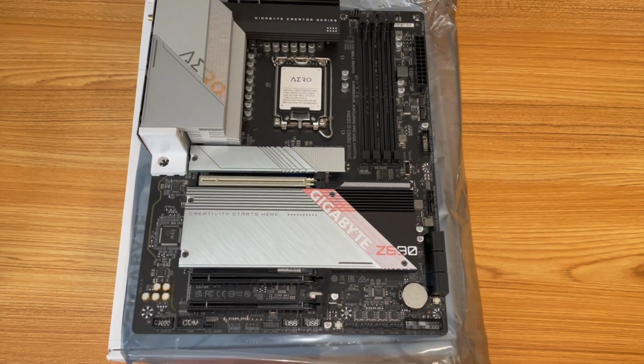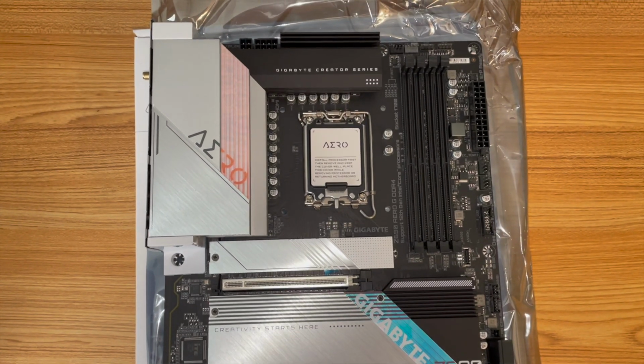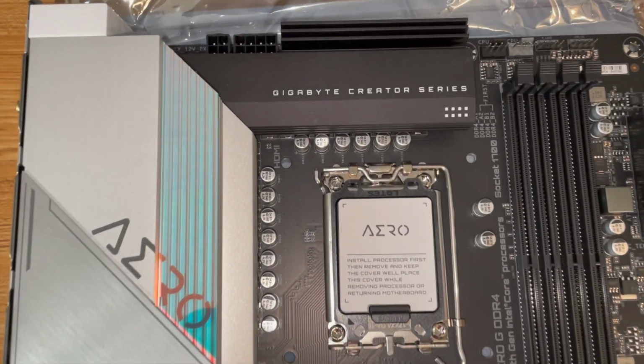Alright, we're back. It's now the future, and it took me a little bit to get this thing set up. It's really my first time using Windows 11, so there were a few quirks. And the memory was giving me problems with this motherboard. It's an XMP 3200 kit, but I've always run it at 3600 with some overclocking. In this board, it booted up fine at 2133, the regular JEDEC speed, and then as soon as I hit XMP and saved it, it wouldn't reboot.